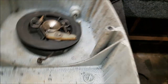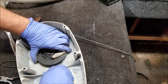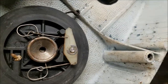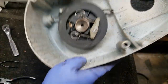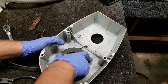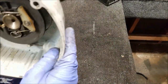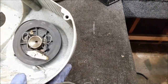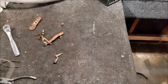I pulled the gas tank out. You can see the slot right there — that's where the spring should be, and you can kind of see it sticking out. So it's possible that's what's wrong with our pull starter. The moral of the story is it looks all kinds of rusted, and given how it's working, that's probably the case. Yeah, you can see it sticking out now. I think we probably just need to replace the spring — not the worst spring I've ever seen, but definitely not the best. Chances are we can get the pull starter working by replacing the spring.